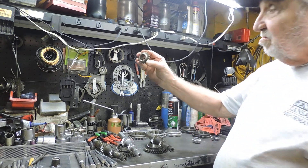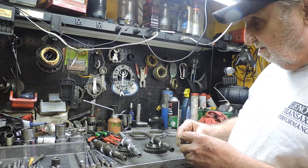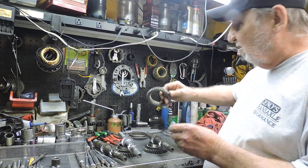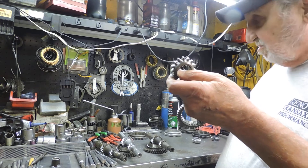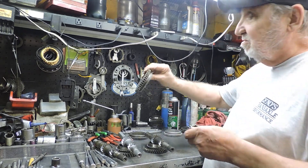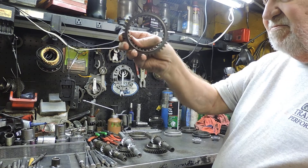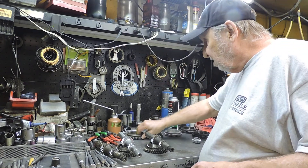You can use this reverse gear — they make one for that slider. If you want to use the late-style slider here, they make a brass cage reverse gear for it. I got them, you can call me. This is the later style super beetle — whatever they use them on — even on '91. Somebody will say they don't, but they do.